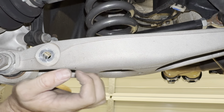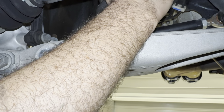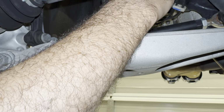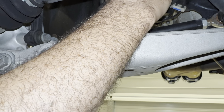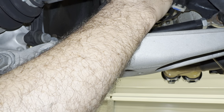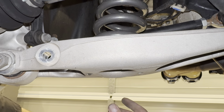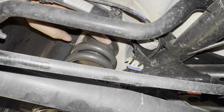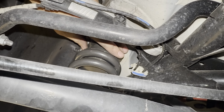Okay, now we got to get that spring located a bit better than that. I'm making that a bit taller so it goes into the hole and it holds itself in there. I have no idea what that's going to be like in length when we're done, but I'll quickly measure it so I can duplicate it on the other side. But I still have the little tab sticking out here. So as long as it started there, it should guide itself in. I'm just going to measure the distance here in the threaded area from the top to bottom. So it's not tight, but it's not going to fall out on me.